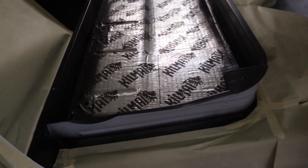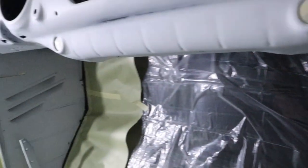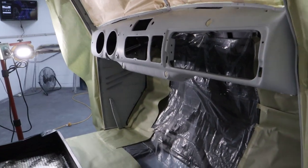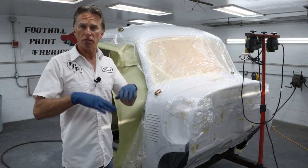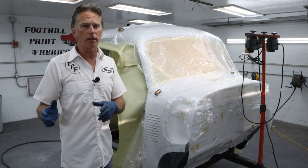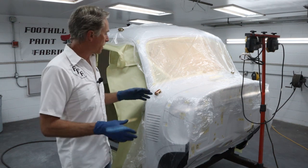We've got to come in here with a Scotch-Brite pad. I've got a little bit of black to scuff where I sprayed that satin. And you can see where these vents are — the louvers are right on the other side. I put some paper in there; I don't want any blowback or color or clear shooting through those louvers and getting on the exterior. So after a little Scotch-Brite scuffing, we're going to blow this thing off and tack it and mix up some black and start spraying. I blew it off really well, but blowing off exposed some paper and plastic flapping around more than I want — that stuff throws dust up in the air. So keep a roll of masking tape handy when you're painting; you never know when something comes loose and needs re-taping.